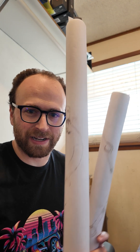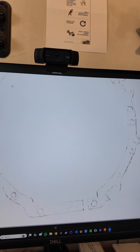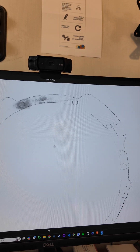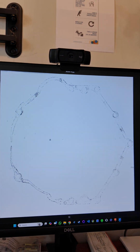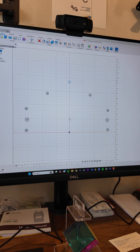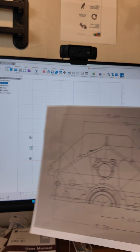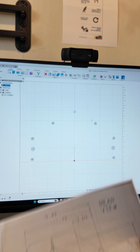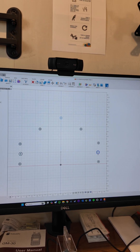I just got back from FedEx where I got scans of the patterns — the sacred scrolls. I should now have both patterns digitized. Here's what that looks like: I've got both bell housings scanned, which will be a great reference for figuring out the overall shape and the hole positions. Now I'm going to bring those scans into Fusion 360. I've already placed most of the hole positions for the LS bell housing based on a drawing I found online, and I'll use those as my reference points to align and scale the scan.